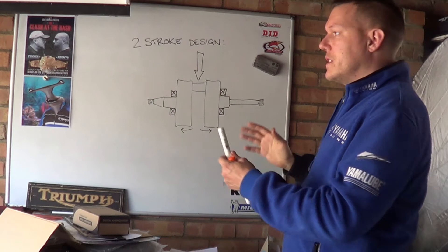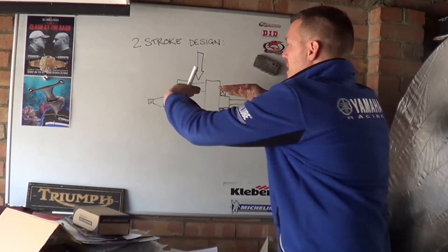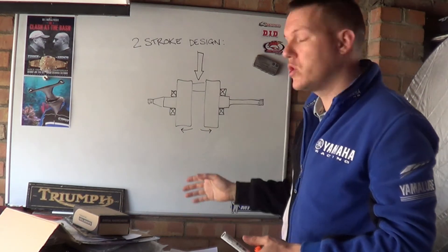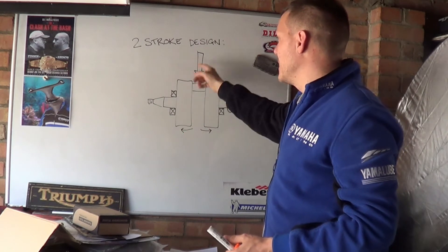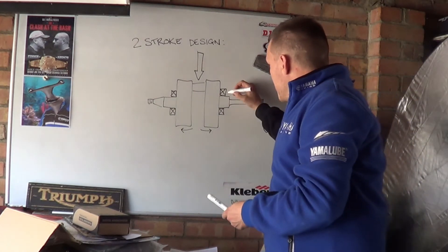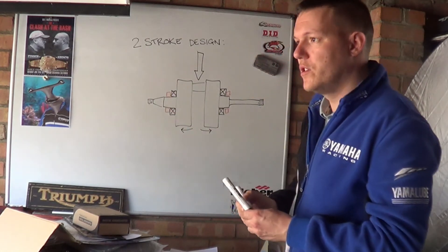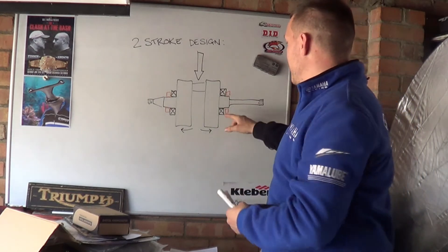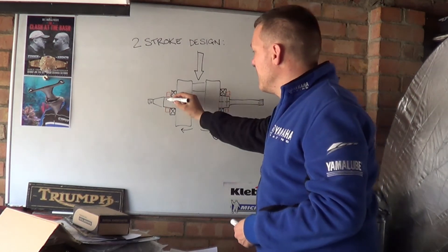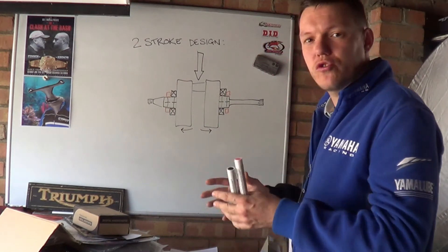The reason we do that is lever action — this whole thing, if it's going to bow out, is going to want to tip, and both sides want to ride out. The way you restrain that is to try and have your bearings as close to this force as possible, because the bearings are basically taking the load every time the piston fires at top dead centre. Then obviously you put your oil seals here because you need to seal your crankcase. If you were to do a switcheroo, then your pivoting action — your fulcrum — instead of being here, it would be out there.